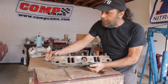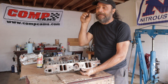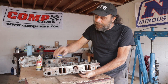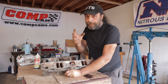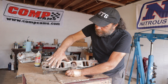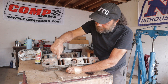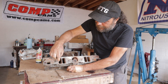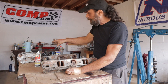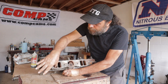Let's start with the intake side. We're using an SP2P intake manifold on this build, and that intake manifold specifically has a smaller port than the standard port in the head. Normally what I would recommend, especially if you're porting for performance, is gasket matching — you just take the intake manifold gasket, fit it in place, paint over the surface, and wherever you see paint around the edges of the intake port you grind those open and match that. But in our case, because we're already starting with an intake manifold that's deliberately smaller in the name of velocity, we're not going to gasket match this — all we're going to do is smooth this entry port.